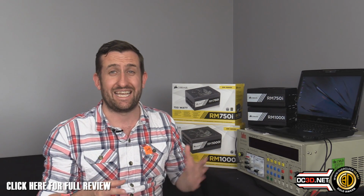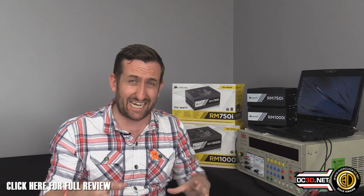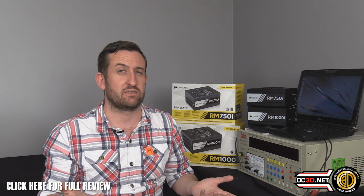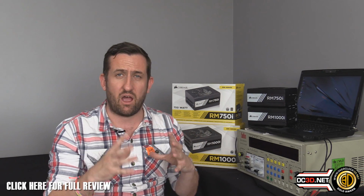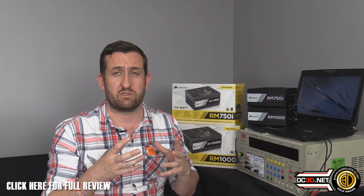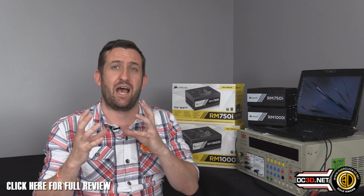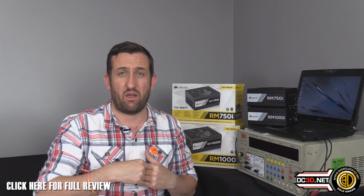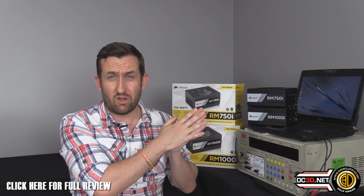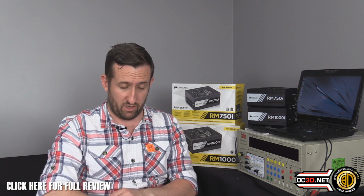I would almost go as far as to say this is the point where your power supply purchases should start, and you should move on from here, unless you're on a ridiculously low budget. But then, you know, you're not going to be running the likes of £300 graphics cards then anyway. Because let's not forget that your power supply is the heart of your system, and you should spend a decent amount of money on it. I would actually tell you to spend more money on a lower wattage power supply than getting one that's just higher wattage. You know what I'm saying. Get a quality lower wattage power supply rather than a cheaper higher wattage power supply. So that would be my advice to you guys out there.